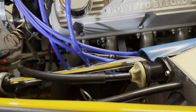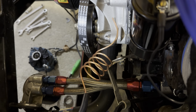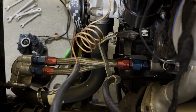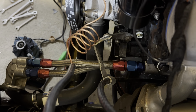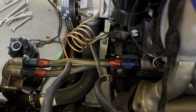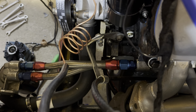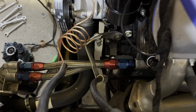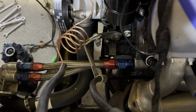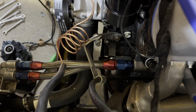Quick update: decided not to cut any of the copper down. I went ahead, stretched it out, put the sheathing on as planned, and then wrapped it around a socket to put some curls in it. One, that gives me a little bit of flexibility for engine movement. Two, it's extra length in case anything ever happens and it needs to be cut or adjusted. The biggest thing was for engine movement — I didn't want a tight fitting line with no flexibility, because with the engine going back and forth ever so slightly on the mounts, it could end up fatiguing over time since it is just thin copper.